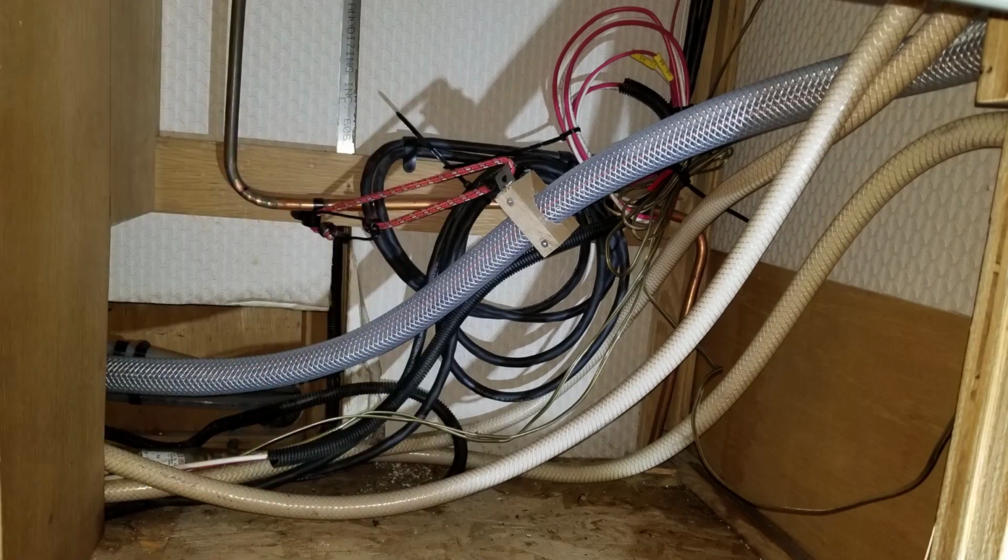So here it is with the drain pipe extended, this mesh kind of pipe. I think it's 1.25 inches inside diameter. It's a little bit smaller than what the other pipe was. The other pipe is very large, but then with the sizing down that they did with the barb fittings in that, it was maybe 1.5 inches. I did a test on this. It drains a sink without any problem in about 30 seconds. In the house, it does about maybe 15 seconds, but there was never a problem with it draining.